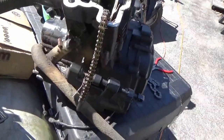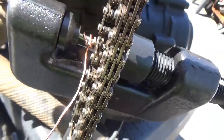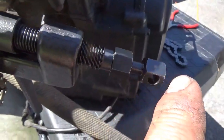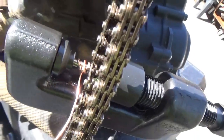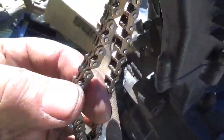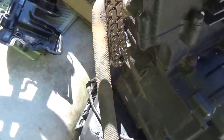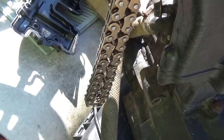I think this is the best technique for putting the chain back together again. Hanging on to that little pin is difficult, and I found that by wrapping some copper wire around it, it was a little easier to hang on to. Now it's just a matter of backing the pin out a little bit, tightening the anvil — back out the pin, tighten the anvil — hopefully it pushes right in and we're all good. All put together, no binding, no problem — they're all in nice shape. If you put them together and one is stiff, if you can tell the one you worked on is different than the others, then you might be in trouble. But it looks good, feels good — now it's just a matter of putting the sprockets on, timing it up, and we're done.